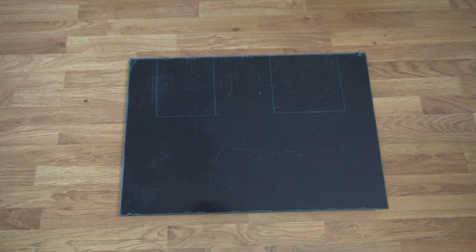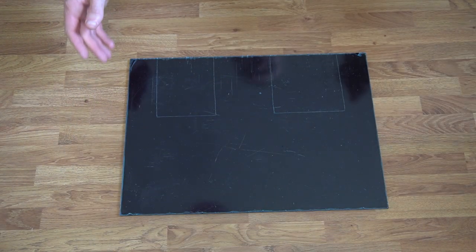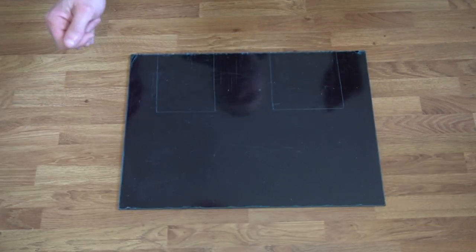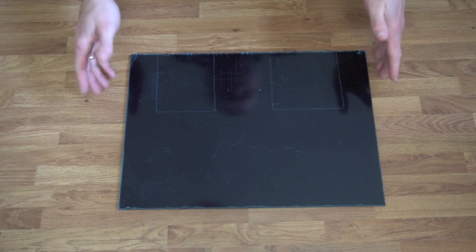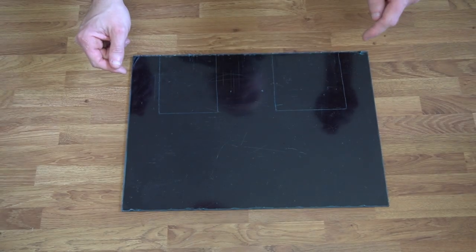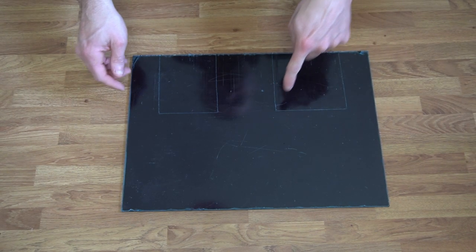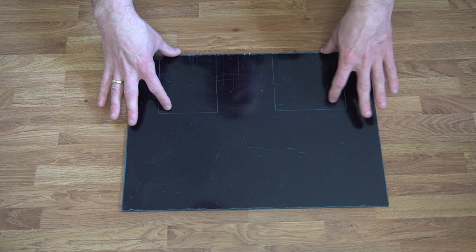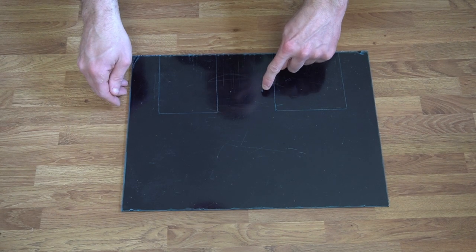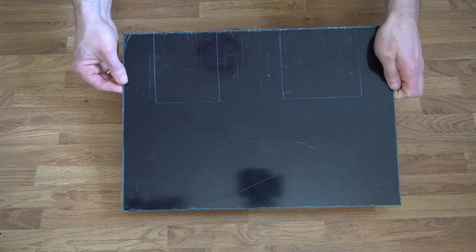And that's what I mean. As soon as you make your template, it gets easier. And all you have to do is mark out the areas you want to remove off your sunshade. So that's the plan, as you can see there. I'm going to use a jigsaw and cut across, cut out these squares and then use a drill bit, probably 4 millimeter drill holes, like so. And then that is basically all I've got to do.